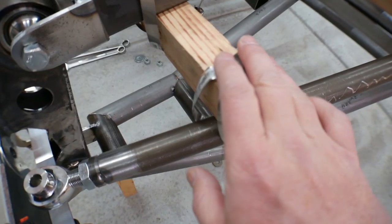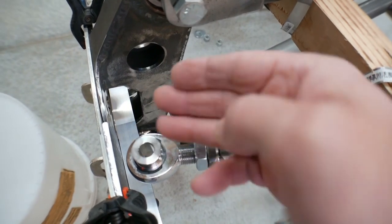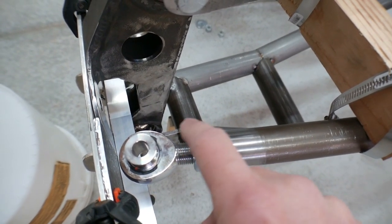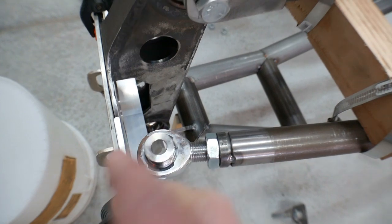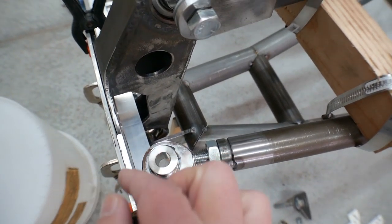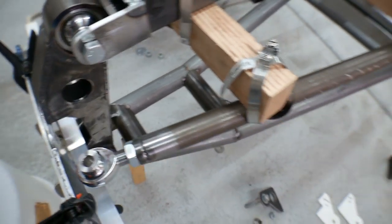In running this parallel I now need to remake the steering arms here, and I also moved my pivot point — it was around here — and if you watched that last video about Ackermann, I moved it out as close as I could to the rotor without getting so close that I need to worry about rocks and stuff getting stuck in there.